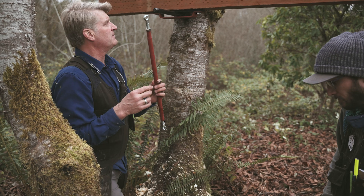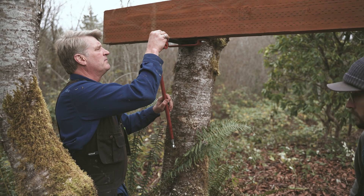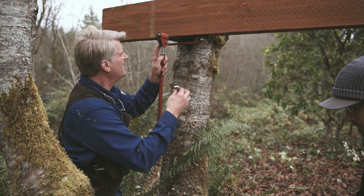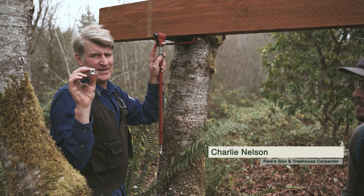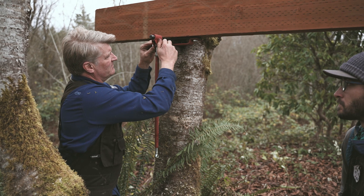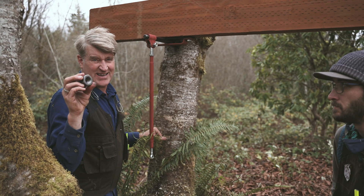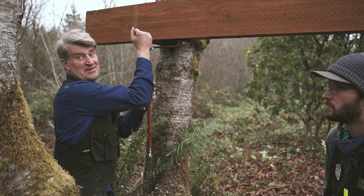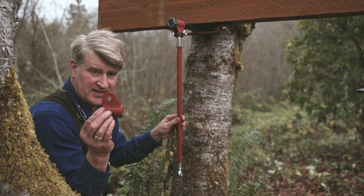It's easiest to put this in position to show you exactly what we're doing. Take one of these brackets and put it on like so — one of the eyes lines up here. We've got a bolt and a nylon locking nut, so we'll screw this on to a degree. The nut goes on the end of the tab and that secures it — it comes with your tab. Everything is now secure up top.